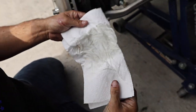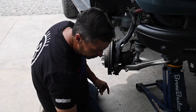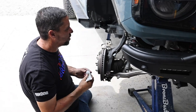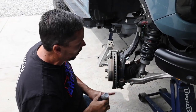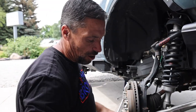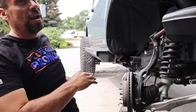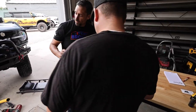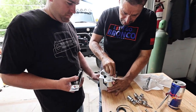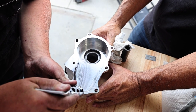Very little debris at that point — there are still a few small chunks but we can call that good. Now apply grease one final time onto the steering rack — put a generous amount but don't get carried away; you don't want grease flying around and getting inside the serpentine belt. About that length spread out on the steering rack. Now apply the gasket maker — make sure the surface on the steering rack side is clean, then put a nice even bead all the way around.